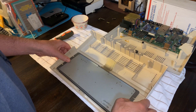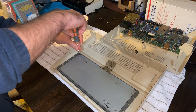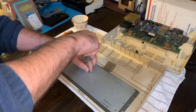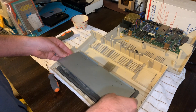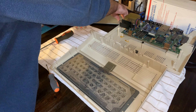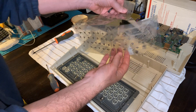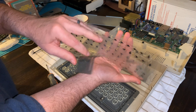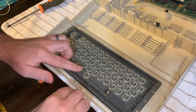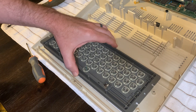To really work on this, flip the case top upside down and set the keyboard back in just so it kind of holds it in place — there's a part you don't want to mess up. There are lots of screws, so you've got to remove the metal back panel. There were about 18 screws or so. Once you pop that back plate off, set it aside. When you pull the mylar off, you see all these springs underneath. The mylar sheet is like a three-layer thing — when you press it, it makes contacts. It looked really good, so maybe I just needed to clean in between there.